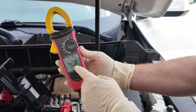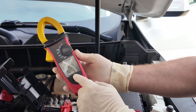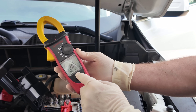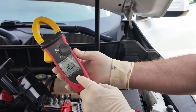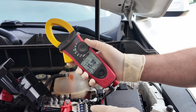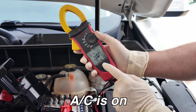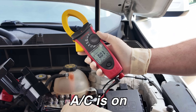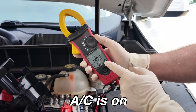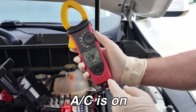After starting the vehicle, we see a max of 14.5 amps — honestly pretty low — and a minimum of 2 amps when the vehicle was just on. Looking at the charging voltage at the battery, it's at 15 volts. When I move the probes and put them right at the battery terminals, we're at 14.9 volts. So now we'll switch out the batteries.